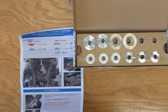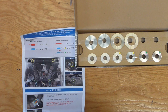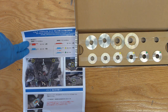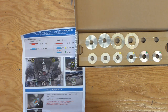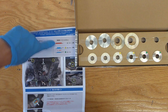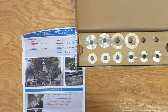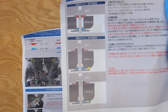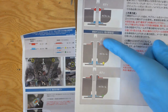We're going to start with the front sub-collar installation. A conceptual understanding of these instructions is much more helpful than the time it takes to Google Translate them — trust me, I did that approach on the last install. These two collars on the left are for the front of the front sub-frame, represented by red for the upper collar and blue for the lower collar. They correlate to these pairs of collars. The other two collars, again red for upper and blue for lower, correlate to the pairs for the rear of the front sub-frame. There's a yellow and a green option that'll be explained later. The other included page has cutaway diagrams so you can know the orientation of the collars. Just look at the size and shapes of the outlines and you can easily figure out how they are to be installed.